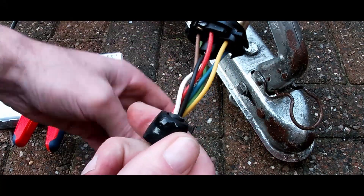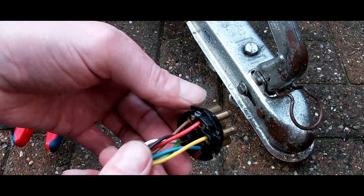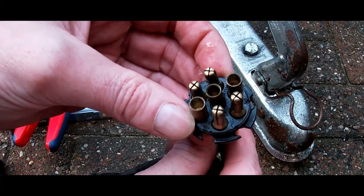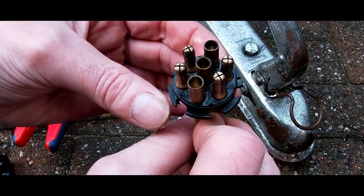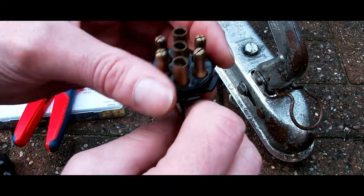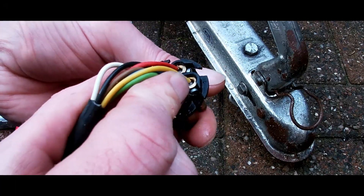One issue was the seven-pin plug that was wired incorrectly, and also a lot of corrosion — the stranded wires were coming away and causing lighting issues. I'm not a fan of that method of wiring a plug, so I rewired it to make sure everything was working, checked the earths on the trailer, and now I'm coming back to this thinking I'm going to redo these connections.